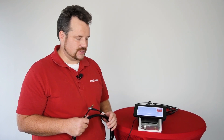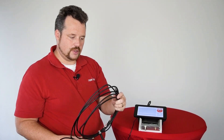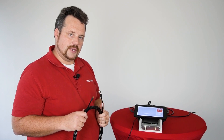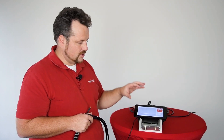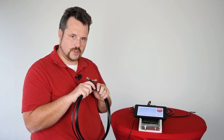One important thing about the cable is that you need a way to measure its quality, and this is actually quite complex. Even a three-year-old cable from our rental pool, if you measure it with a normal standard multimeter, would show a correct and okay electrical connection — but that does not mean that at 900 MHz it's still a good cable. In our production testing, we use a custom tool we built that does the same thing as the fancy measurement equipment on my desk. It applies a signal at 900 MHz and uses two ports to measure how much of that signal came through. We use this device for every single cable we produce and also to periodically check cables in our rental pool.